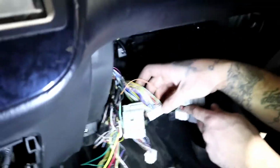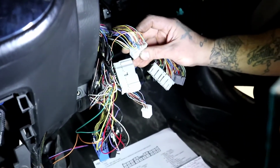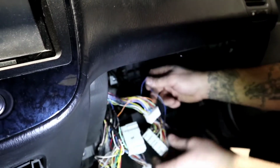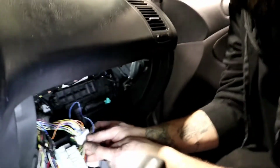All right, so that extra blue and white wire is for the VSS. Sorry, not VSA, VSS. The automatic cars do not come with that wire. So you'll have to put that in E-plug number 25, right? E-plug number 25, blue-white wire. After you've installed it in the E-plug, you'll have to wire it up to the blue-yellow wire that I cut.